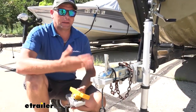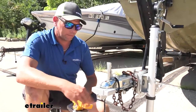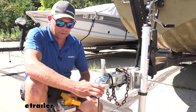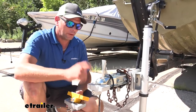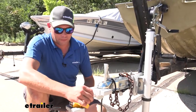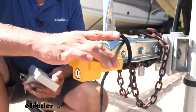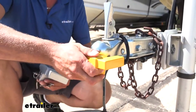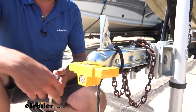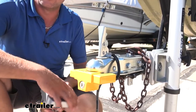This is probably one of the most common couplers you're going to find — just bolted onto a square tube. We see these all the time. In this case, the two-inch is actually a little bit more snug and fits on there really well with no forward or back play. I really like the way that one fits — I think it'll do a great job. Let's switch to the two-and-five-sixteenths and see how it works. Again, on a two-inch coupler, the two-and-five-sixteenths definitely has a little bit of side-to-side and front-to-back play. On this style coupler, I'd go with the two-inch. The only time I'd go with the two-and-five-sixteenths is if I had a two-and-five-sixteenths inch coupler.